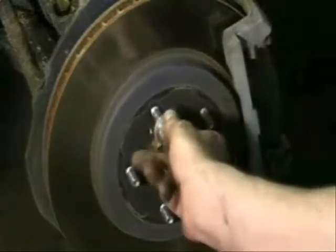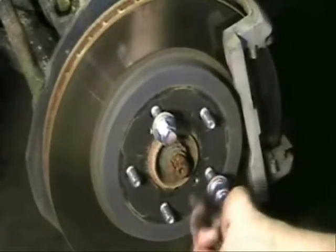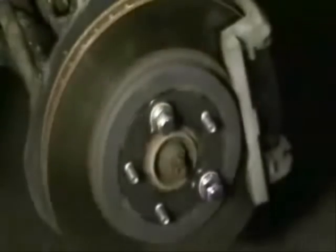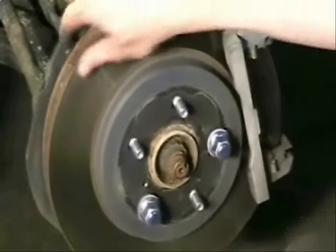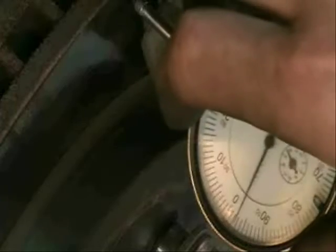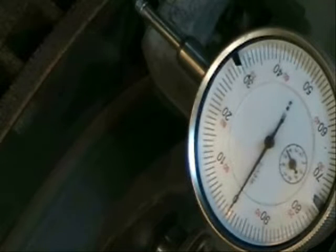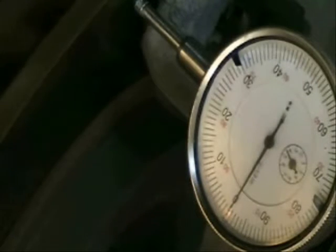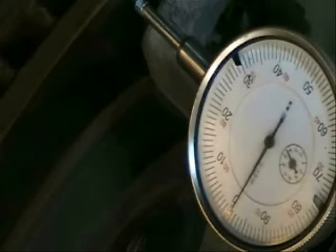The first step: reinstall two of the lug nuts so that it holds the rotor firmly in place. Now the rotor won't be able to wobble, so we'll get a true reading of the run-out. Notice I can turn the rotor — this is the reason why I put the transmission in neutral earlier. Here I've got the dial indicator set up on a point on the rotor within the brake pad contact surface, and what I'm going to do now is just turn the rotor and look for run-out — and there is less than a thousandth of an inch.